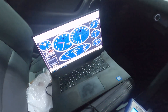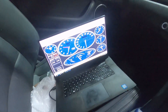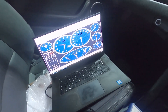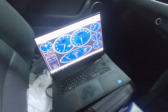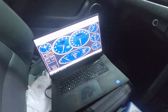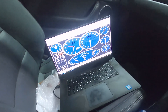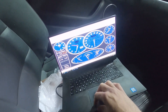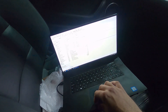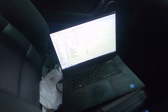So the car is working and started. Next session we need to put it on the dyno and actually tune it. I haven't decided how I'm going to approach this because the ECU has a MAF sensor, but the MAF sensor is now positioned under boost and I'm not sure how it will respond to boost. The other option is to switch the ECU to a speed density setup, since this ECU has the ability to run both MAF and speed density — we could just remove the MAF and run speed density. There are a few percent on the fuel trims, so a little bit of dialing in to do. EFI Live is a good system for getting into these LS ECUs — another popular one is HP Tuners.